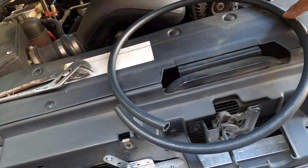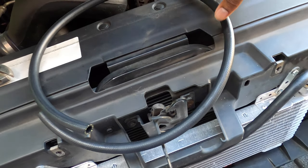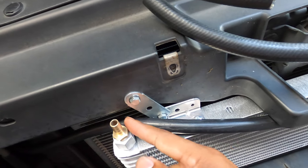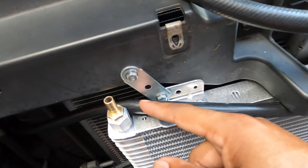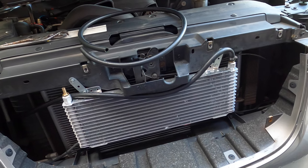Just got back from the store — four feet of hose, eight dollars a foot, which is absolutely crazy. I'm going to run it from the hose on the trans cooler to the hose that goes to the transmission and figure out the routing. If the hose stays near the aluminum I'll need to put a barrier between them because that rubbing will wear a hole in the hose, and that's not what we want. I'll be back once I get this all figured out and then we'll start it up and make sure nothing leaks.